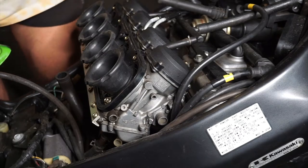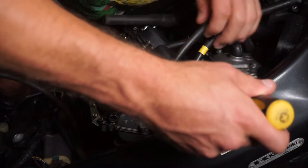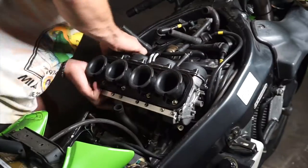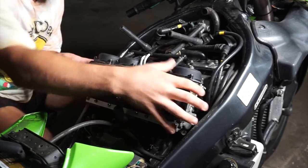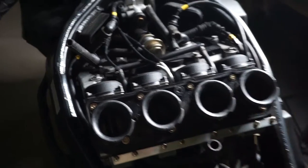Now I'm going to take the carburetor off. We're going to use a long Phillips head screwdriver to reach right in here and loosen up the clamps — there should be four of them. Before I just go ahead and take the carburetor off, I want to show where everything is, not only for you guys but also for myself, so when we put it all back together I know where it's all going.